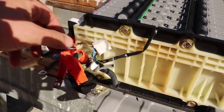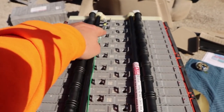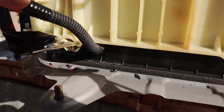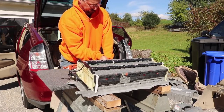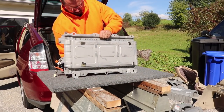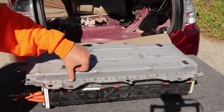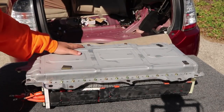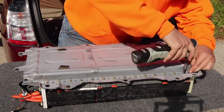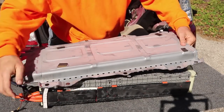Here's the wire - this goes to the current sensor, then on the other end the green wires go up on top and all the way down, but this other part goes down under the battery pack and that's what I've got to get at now. Next I got out a piece of plywood as a protected material to flip the battery over on, being careful with the sheet metal - it bends real easy. Unfortunately this isn't a simple cover to remove; there's actually a little bolt going into every single cell module, and I'd have to unscrew every single one of those to get the cover off. Here's some time-lapse of me removing all of those bolts going into the cell modules, and then after that I was able to remove the sheet metal cover itself.